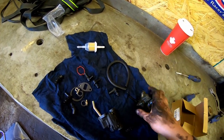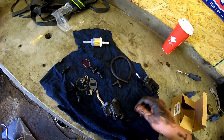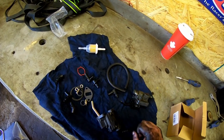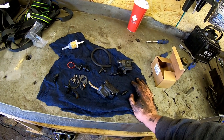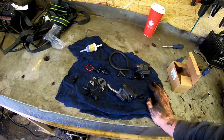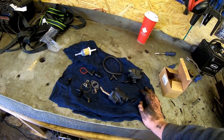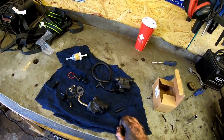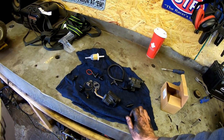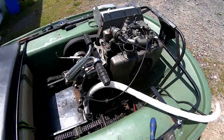Important note: if you're going to buy one of these fuel pumps, make sure you get an OEM-quality one — a Kohler or genuine part. I ordered one off Amazon and it worked for one day. On another Argo I replaced a pump on before, that one failed after a couple of uses too. Get an OEM pump to save yourself the hassle. I've had to hook up an electric pump temporarily in the meantime.